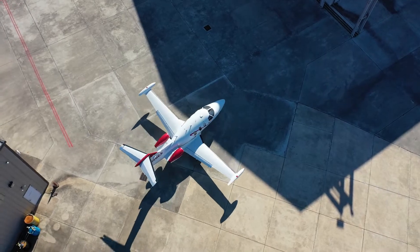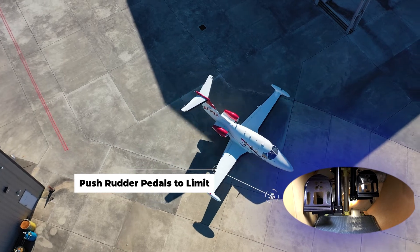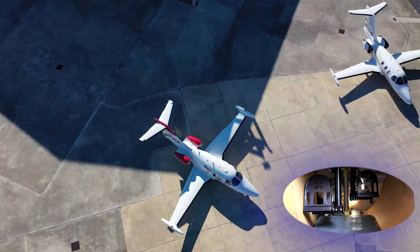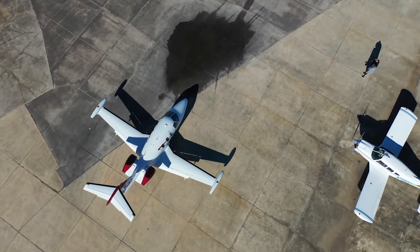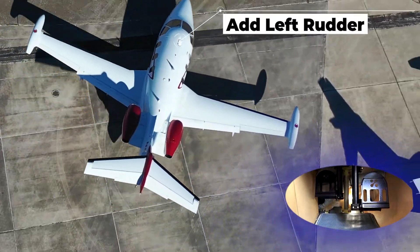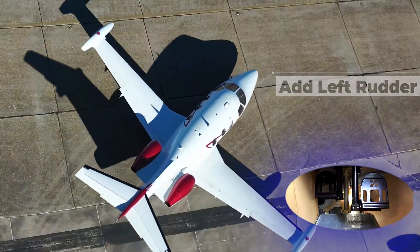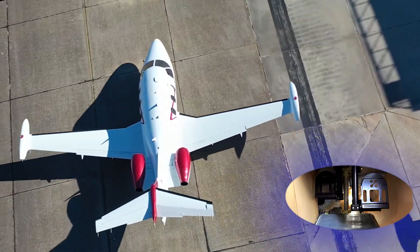The way you do this is you push the rudder pedal until you get the nose wheel into its limit where the nose wheel is not traveling anymore in that direction. Then you add opposite rudder while you're touching the brake in the direction of desired travel. So if you start with right rudder, then you add left rudder while you're holding the right brake — holding not too firmly. The nose wheel is going to break loose further to the right and enter free castoring mode.